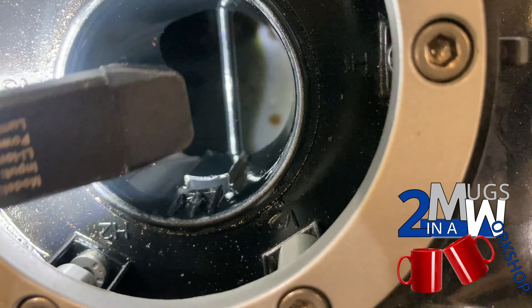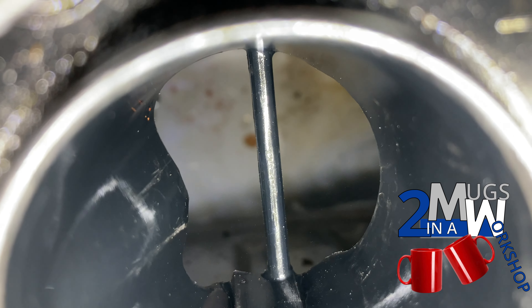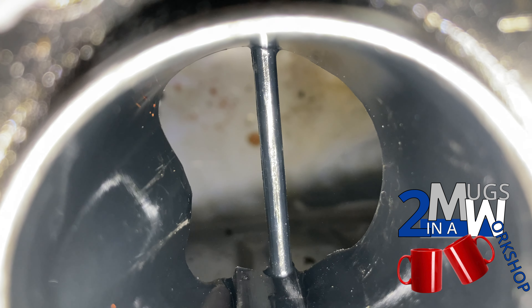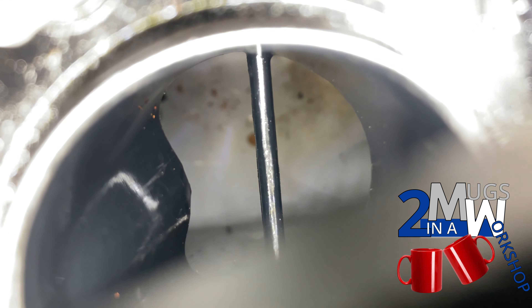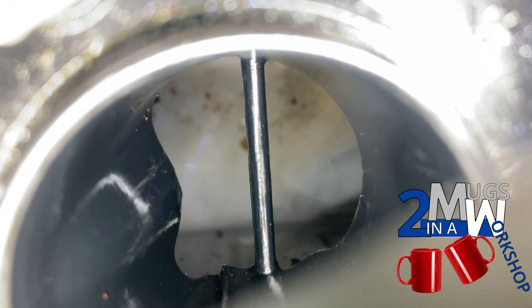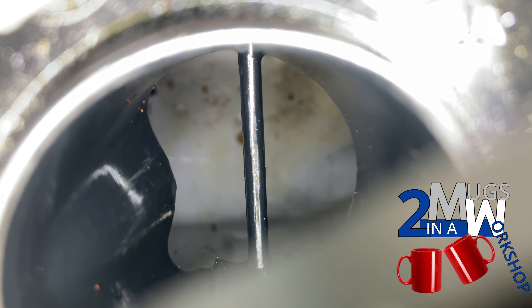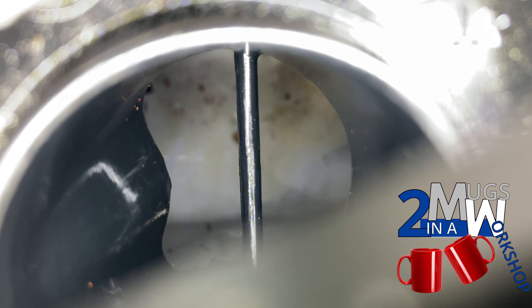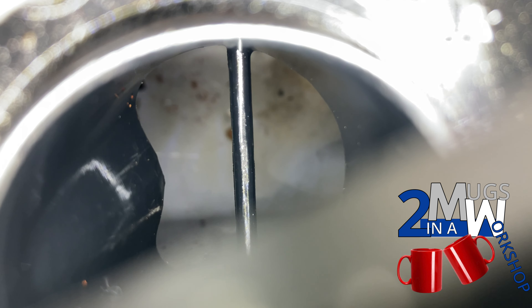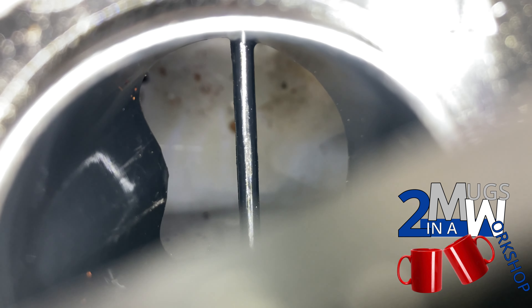Looking down the bottom of the tank you can generally see a few brown spots at the bottom — that's what the inside of the tank looks like, and there is a bit of rust in there. It's not horrendous though. I think what we're going to do is just replace the fuel filter, and we might try and cut open the old fuel filter to see if we can see any rust or orange debris in there. For me it's not bad enough to replace the tank. If the tank ever does need replacing it's dead easy to get to anyway — hardly any extra labour to take a few bits of fairing off at a later date.